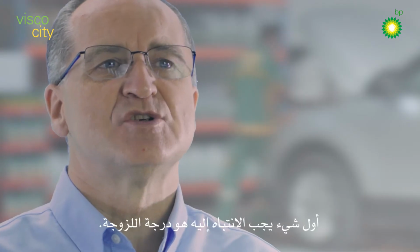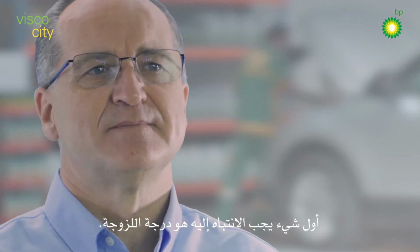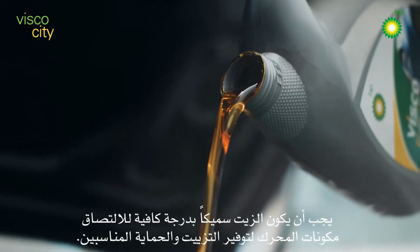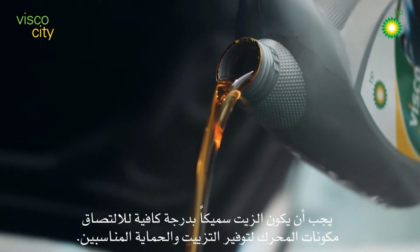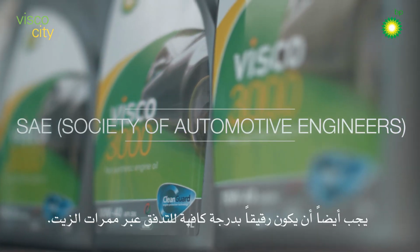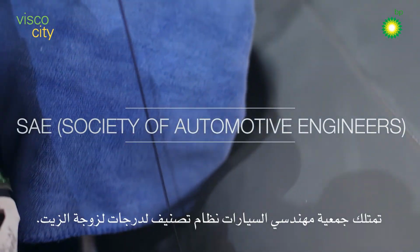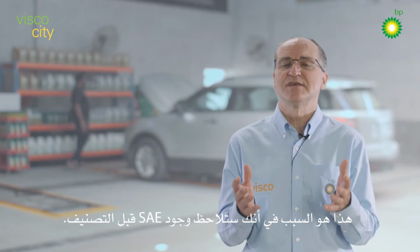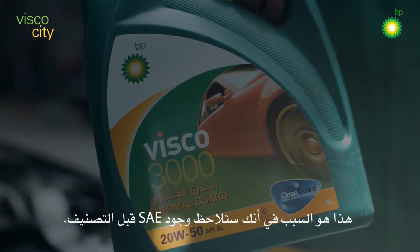First thing to pay attention to is the viscosity grade. The oil must be thick enough to adhere to the components to provide adequate lubrication and protection. It must also be thin enough to flow through the oilways. The Society of Automotive Engineers has a classification system for grading oil viscosity. This is why you will notice an SAE before the grading.